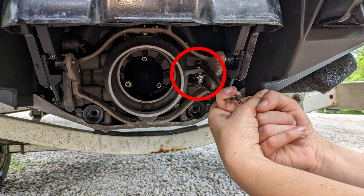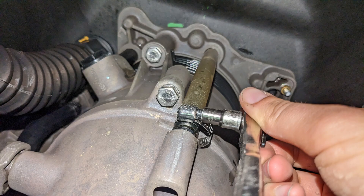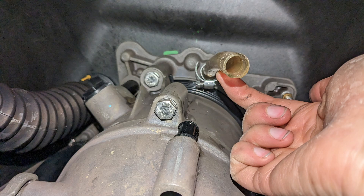Next we're going to need to remove the steering cable. Again, a wrench and a ratchet — we can remove the nut and free the cable end from the steering nozzle. Using a quarter-inch socket, we can remove the bilge siphon hose.